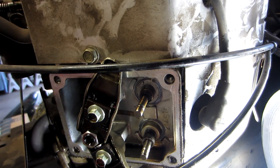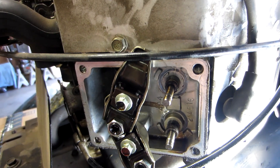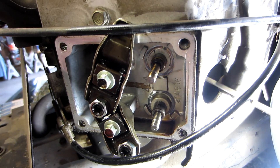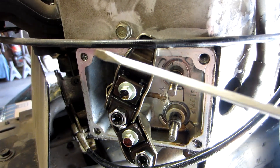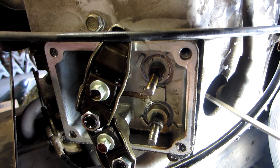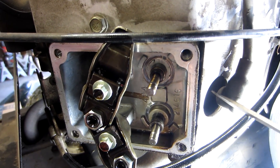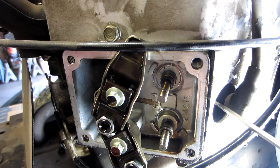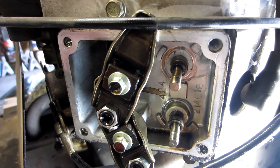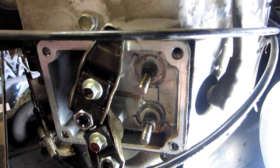You've got to be careful at this point because there's nothing holding these valves from falling into the cylinder. What you want to do is make sure the valve has something to hit. Put the cylinder at bottom dead center — meaning if you put a screwdriver in the spark plug hole, it will go as deep as it can when you rotate the engine slowly by hand. Once it's that deep, take a pull rope from a push mower and feed it into the hole, a real long one, leaving a little bit hanging out. Once you get as much rope in as you can, slowly rotate the engine to top dead center. That holds the valves from falling inside. When done, rotate the engine back a little, grab the end of the rope, and pull it out.